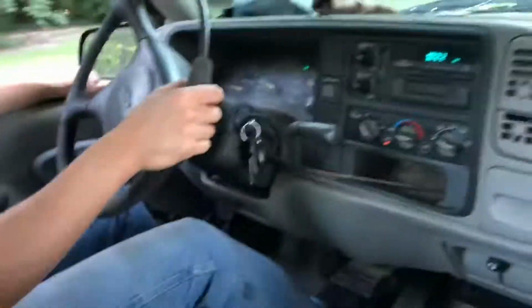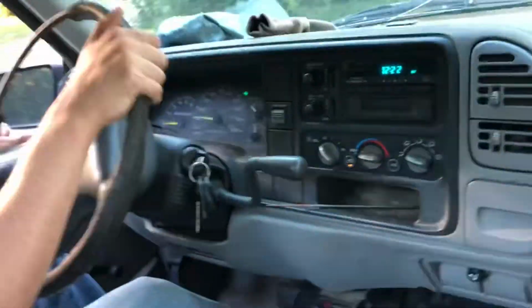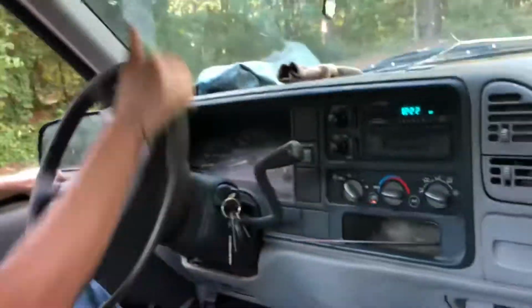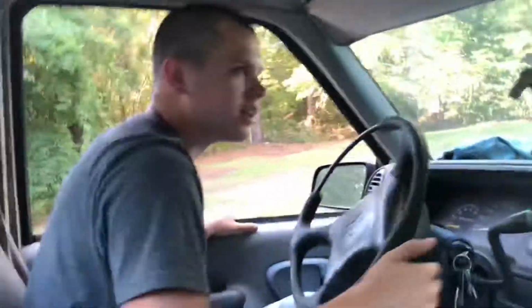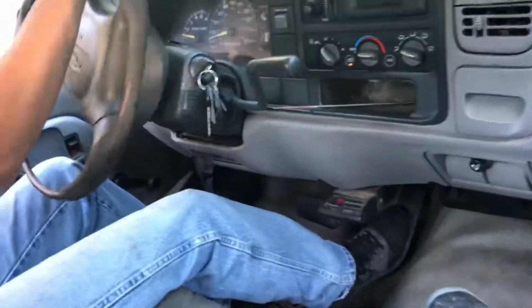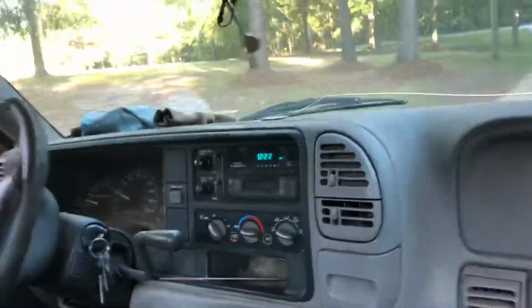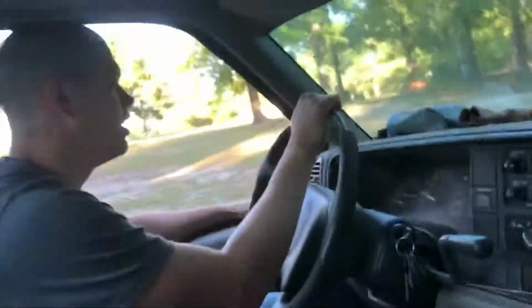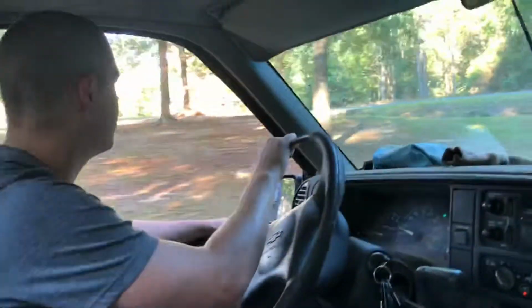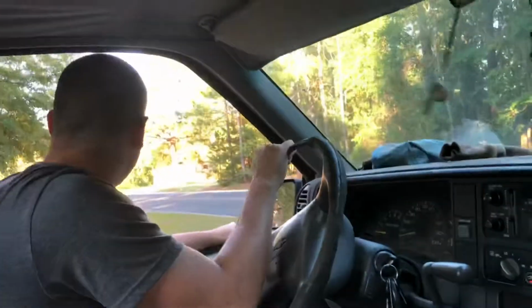Don't want to drive it too far up the road because it ain't got a tag or insurance on it, but turn around here. As you can see, it comes in and out of gear smoothly. Brakes are stiff, but they do work. The reason we parked it is we thought it had trouble with the distributor cap. After it had some strain put on the engine, I think it fouled it out because it done that a few times in the past.